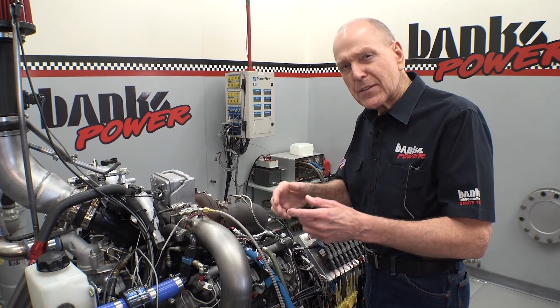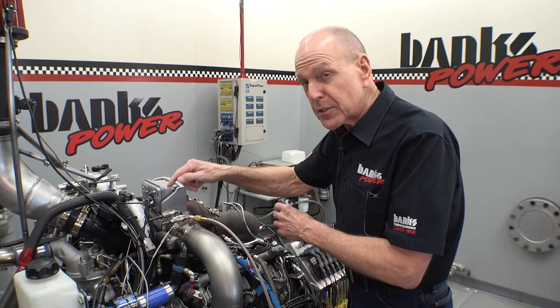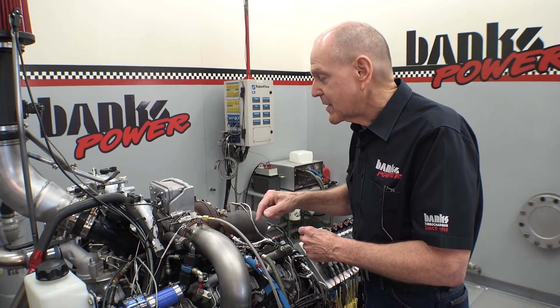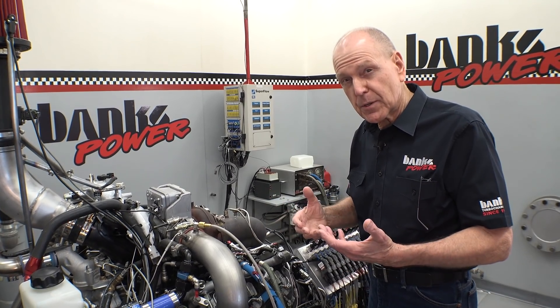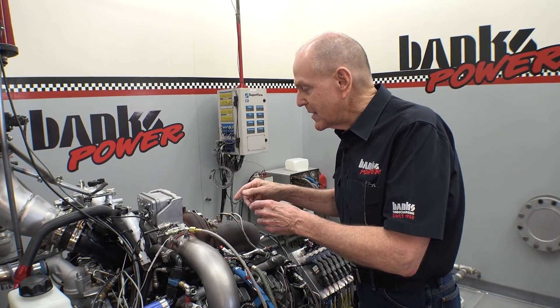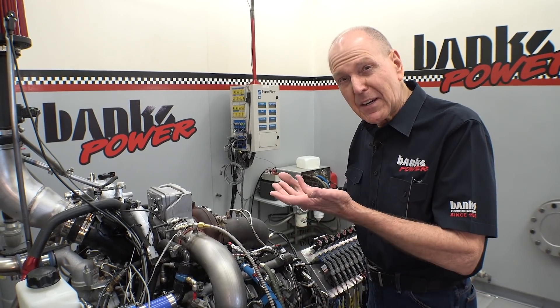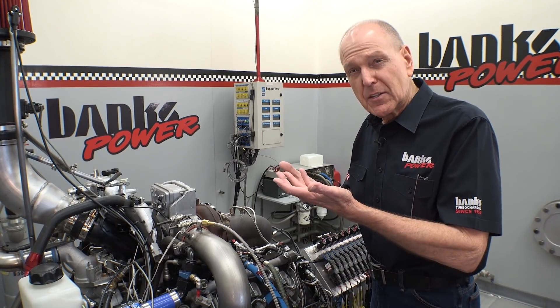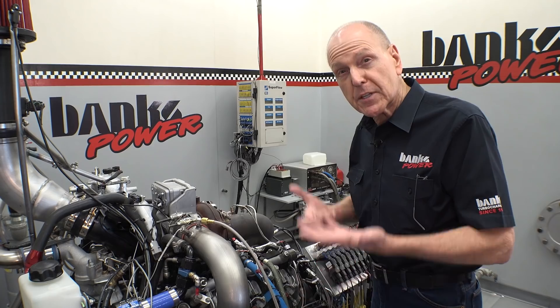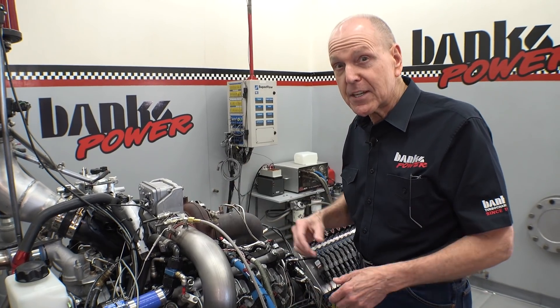My focus is on the turbine because we've been seeing turbine inlet pressure or drive pressure going to the moon. You've got to look at the ratio between the boost pressure coming out of the compressor and the turbine inlet pressure driving the turbine. When they're the same, that's what we call the crossover point. When the turbine drive pressure is higher than the boost outlet pressure from the compressor, you've got a negative situation — you're corking up, holding heat and exhaust energy in. The turbine is in choke. It's really hard on power output; it keeps heat and pressure in the cylinders, so you're pumping the pistons against the back pressure of the turbine during the exhaust stroke. That takes power out of the crankshaft that you put in with the compressor. Sound upside down? It is upside down.